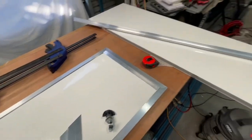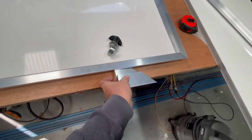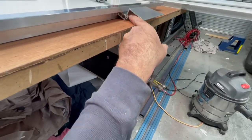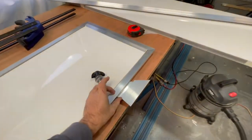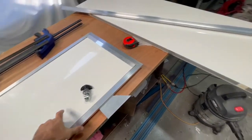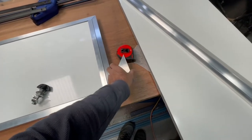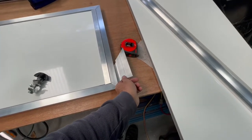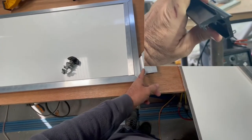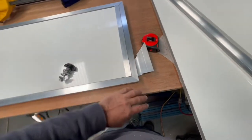I've got all of these panels cut to measurement where I allowed for the size of the profile. I've also complicated this further by putting in a Centaflex hinge - when mounted on the van, I've got to leave an 18mm gap for my hinge. I've got a PVC Centaflex hinge; they run along the edge that's going to be hinged, they're 18mm, so I had to allow for that. It'll be glued to the top and also screwed into that profile, so I had to allow for that.